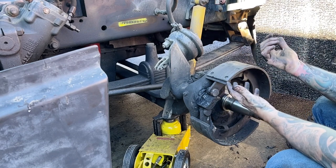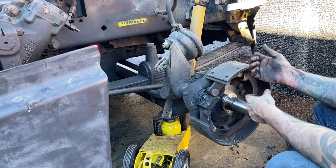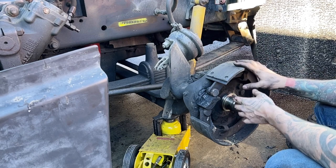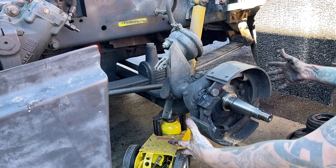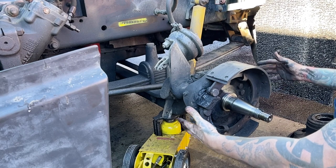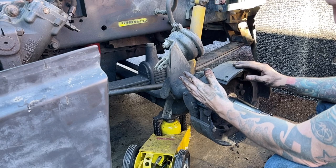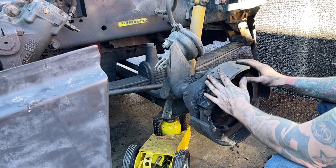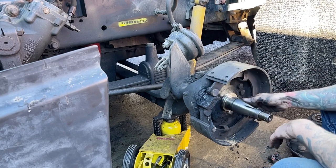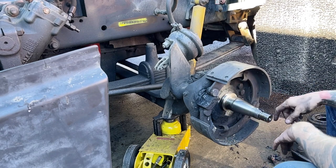If you're one of those guys that is in the wrong gear and you're going to have to ride your brakes, these things are going to get hot quick. Within the first couple of minutes, these things are going to be glowing red and you're going to have full expansion on your drum and your travel is going to be gone on your chamber, and you're going to have brake fade and you're going to be going 100 miles an hour with no way of slowing the truck down. So you guys all know that. Everybody who drives a truck knows that. That was more for people who don't drive trucks but are going to start driving trucks because they love my channel.